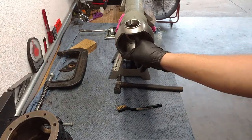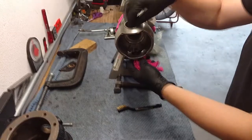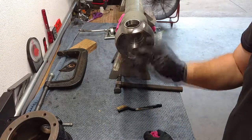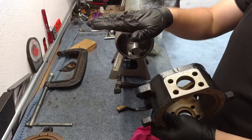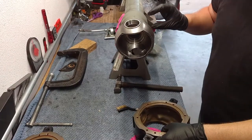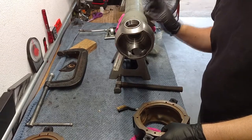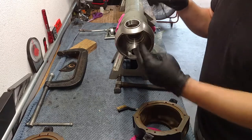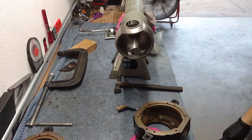For now I'm leaving out the inner axle seal. My intention is just to get the knuckle on with these bearings greased for the sake of getting my shim quantity correct. That way I can have this knuckle on the axle, steering arm on there, and start looking at steering parts. I know I have to weld some steering stops to this, shock mounts to the top, and possibly sway bar brackets. I don't want to apply a bunch of heat with that seal in here, so I'm just going to skip it altogether for now.